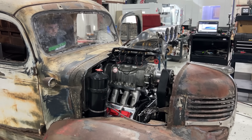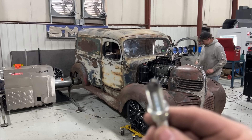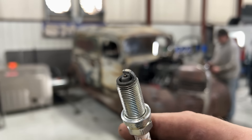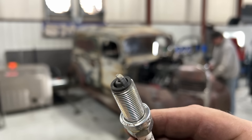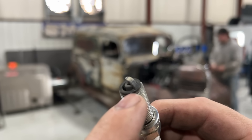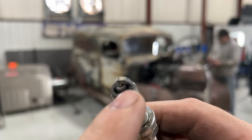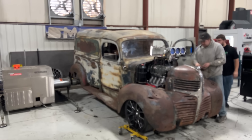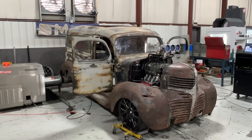Here is the spark plug — that is pretty darn safe. That is your timing line right there. It could definitely have more timing — we're at 20 degrees right now and that's super safe. It's making the horsepower. We went to 3.3 instead of 3.5 where we're hunting for 3.5 to 3.6. So I think we'll leave the timing low, play it safe, lean it up just a little bit, and speed up the dyno because it's got a little too much load for that power level.